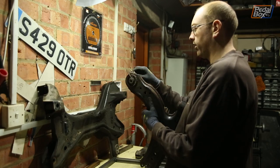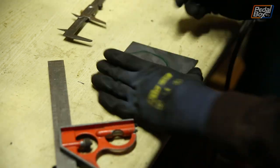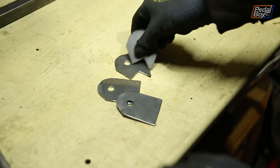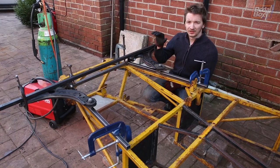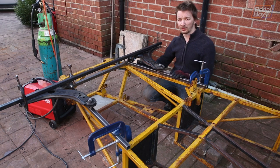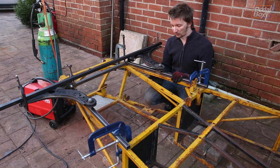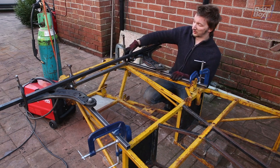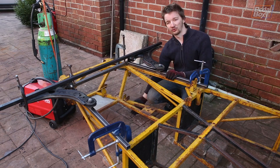We're making this piece 10 inches long. These stubby little wings here are our lower suspension arms, so the hubs are eventually going to fit onto the ends of these. We've got them fitted up on top, clamped onto the original body, to make sure that although we think we've got our measurements right, it's actually the same kind of wonky as the original framework. Now that we've got it vaguely tacked in place and looking good, we're going to get a reinforcement brace in across the centre, and then we can start moving this down into the bottom of the chassis.